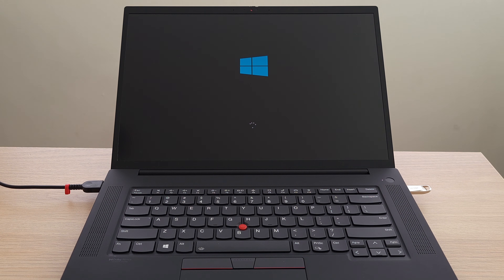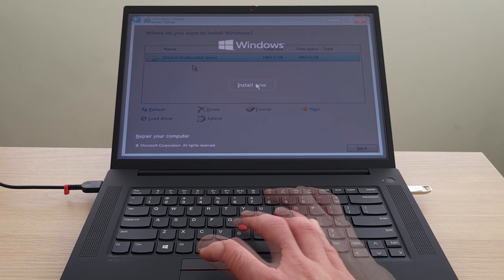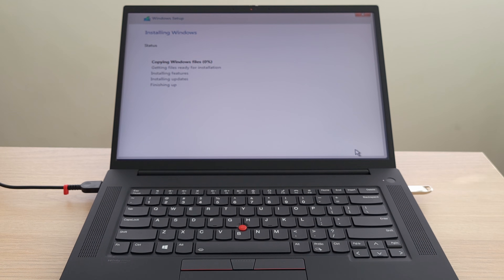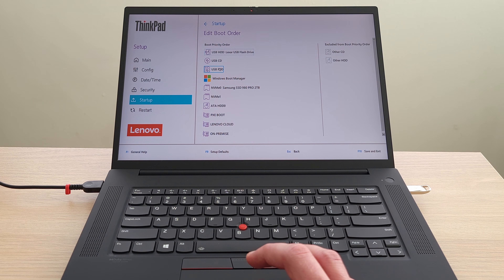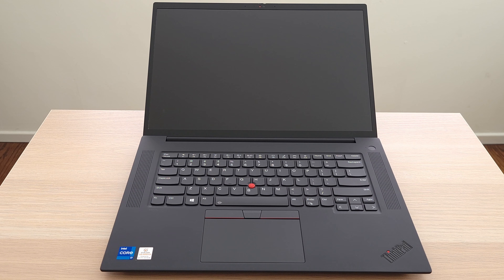Follow the instructions through Windows. You'll see our new unallocated blank hard drive installed at that location. If you already have Windows on the hard drive, just make sure you pull the USB drive to the top of the boot order in the BIOS. Windows didn't recognize the trackpad nor the wireless adapter with the default install, so I had to install the Wi-Fi driver from the USB stick. Once online, Windows configured the trackpad, but I did have to use the trackpoint during installation. A USB mouse should also work.